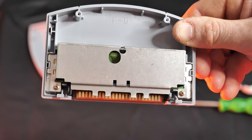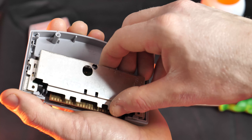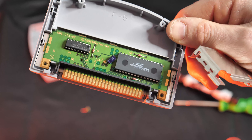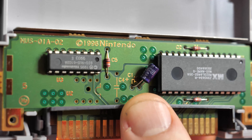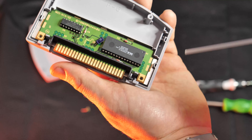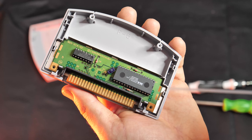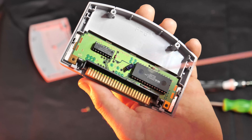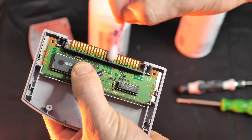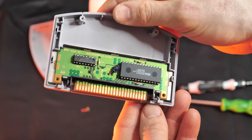At first glance this looks pretty good, but we're still going to remove these two tiny screws to get to the board. With the screws out, wiggle off this heat shield and now we're inside the N64 cartridge. Isn't it crazy how small the actual video games were back then? Right there it says Nintendo 1996 — that's how you can tell if it's legit. Give it a little spray with the compressed air to clear out any dust. Then bring back the isopropyl alcohol and give it a small swab — put the rubbing alcohol across the pins both front and back. Once you're done, quickly dry it with the compressed air.